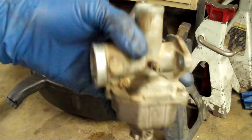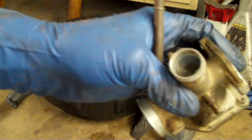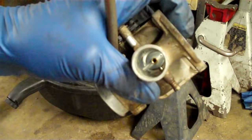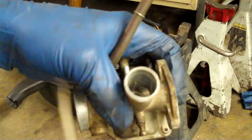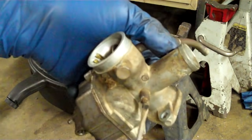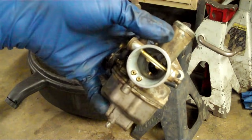Now I'm going to go to the bike to show the next part. The barrel that goes into here that blocks it is basically the throttle butterfly. It goes down into here, and you can see there's a screw on the side. The screw meets with a sloped surface on the throttle butterfly. As I screw it in, it'll push up on the throttle butterfly because it's cut at a slope at a 45-degree angle. So the more I tighten this in, the higher it holds that open — it's like twisting the throttle.